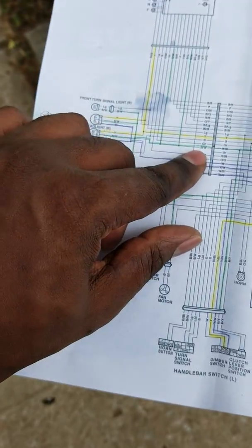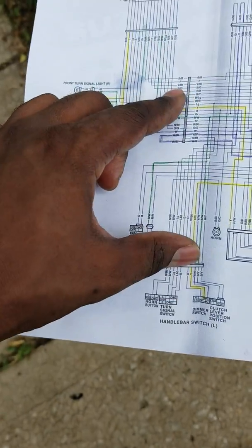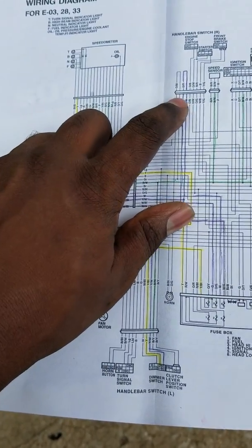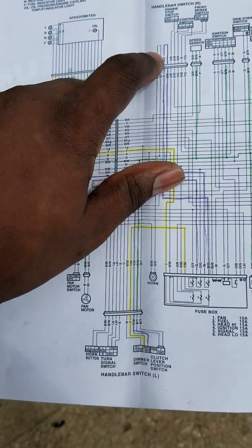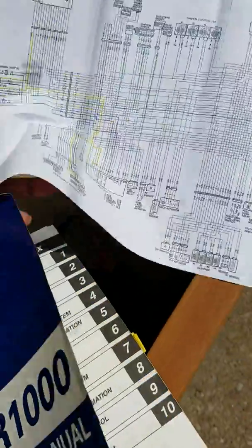You want to check those three wires inside of your three areas of your connectors. You'll see the main two, but what you'll also notice is that in this connector, the yellow white wire comes in, it leaves the connector, and then it comes back out orange and red. It doesn't do anything, it just loops. But like I said, anyway, check those connectors.